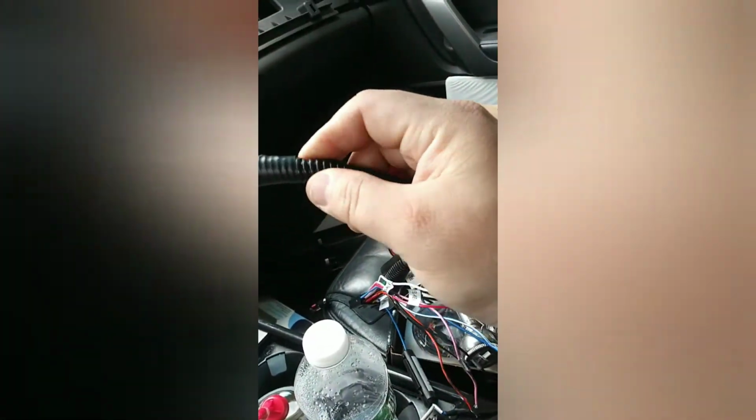The wiring harness. Now, as you can see, the cables for the speakers will come here like this in one whole thing, and you'll think, oh, okay, I just gotta plug it in and that's it, and that's not the case. You're only gonna need the power cable, which is yellow, black, and the red ACC, whatever one is. That's the only one that's gonna work. The rest of them are just a waste. All right. As I said before, I'm connecting my tweeters and my center speaker here to the radio, and everything else is going to be connected to the amp.